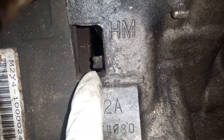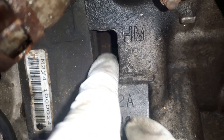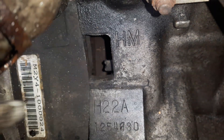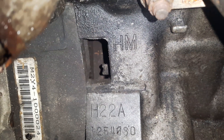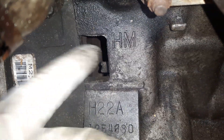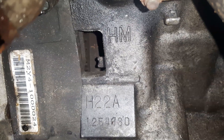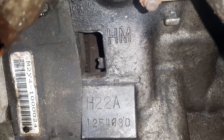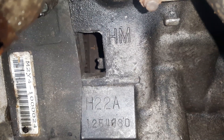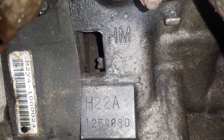Number one is at top dead center, and the proof is right here — the timing mark is showing. This is slightly off because the timing mark is actually 15 degrees — plus or minus 2 degrees — so 13 to 17 degrees before top dead center. This is also a way to check ignition timing. On this engine it's not possible to adjust the timing once you set the timing marks and put the belt on — it's not adjustable after that, so it should be like this.